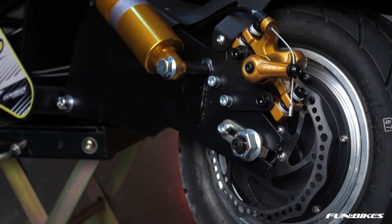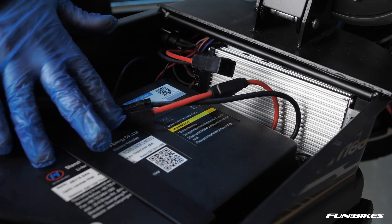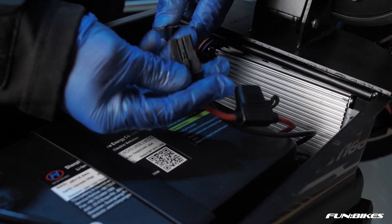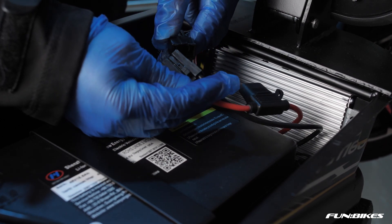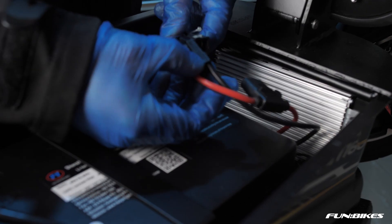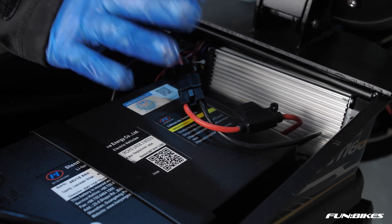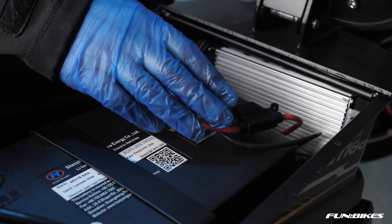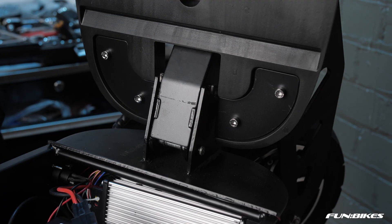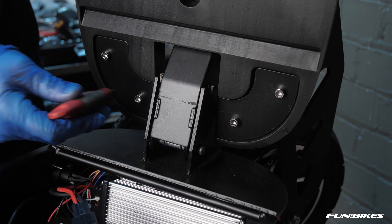We are now ready to lift the battery compartment and connect the battery on the scooter. Take the two plastic connectors and push them together — they will clip into place. It will either make a small spark, pop, or crackling noise as you do so. Your battery is now connected and ready to go; charge for 12 hours before the first use. We also need to make sure that the deck is secure, so while you have the deck lifted use a 5 Allen key to make sure it is mounted securely.